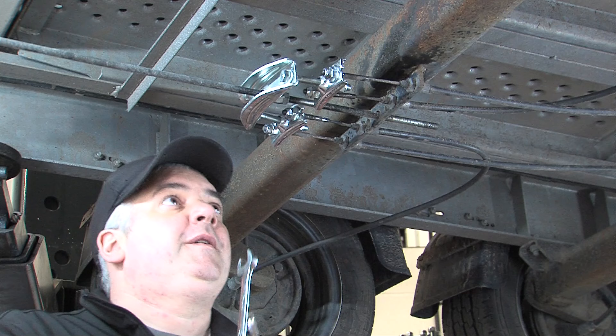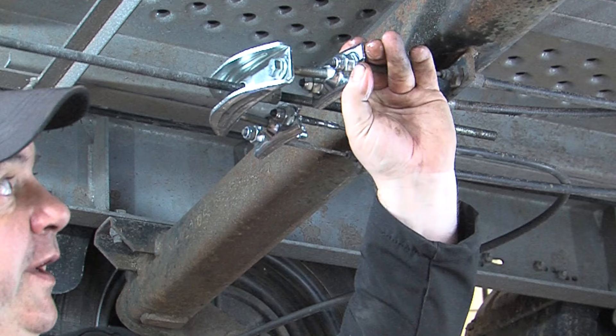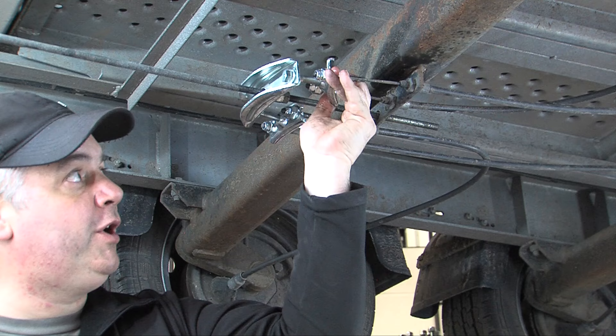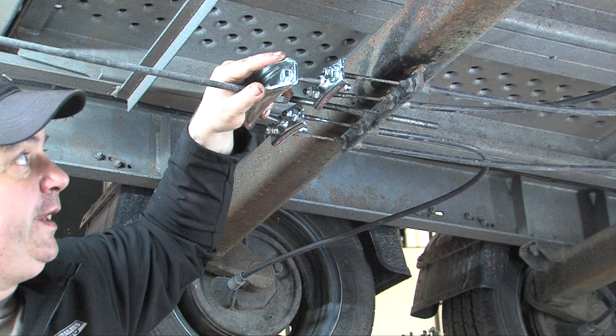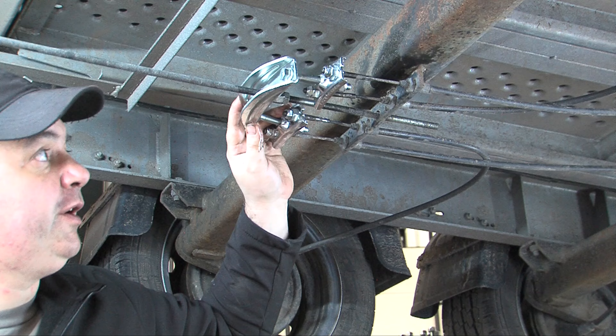This will allow everything to pivot correctly. It works far better than the other compensator that was fitted, as everything uses domed nuts and it allows a lot more articulation between the two cables and between the left and right hand side, or the front and rear axle depending on how it's been set up. This can cure a lot of problems with brakes not acting as they should, which is why we always use this compensator on any trailers that we do maintenance on.